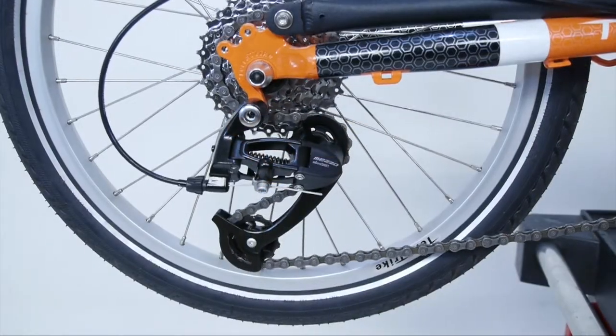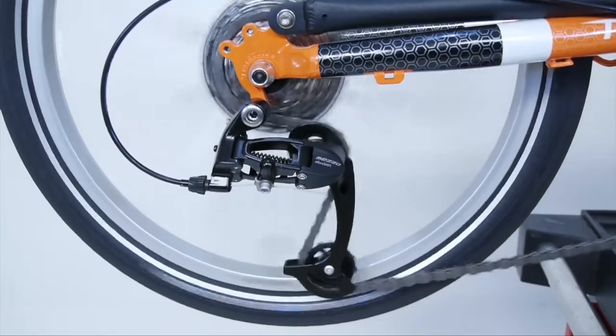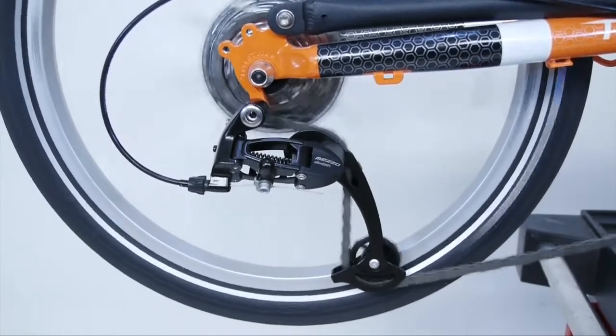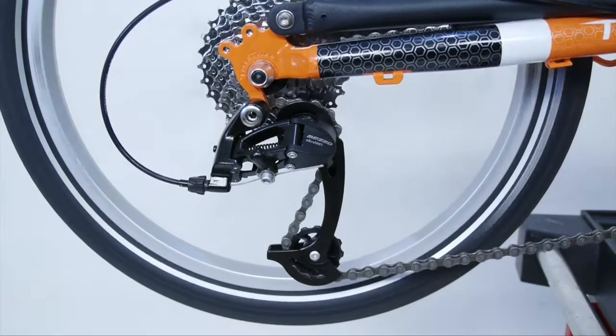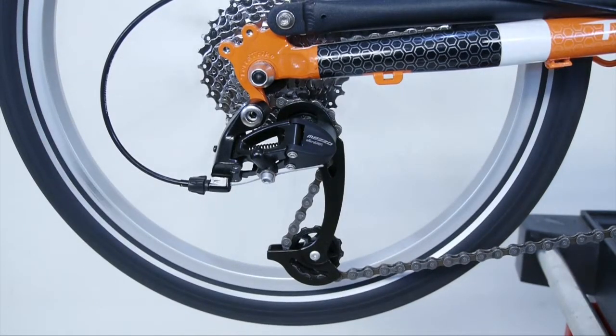If a trike is used for demos or test rides, always check the chain length before sending a customer out on the ride. To quickly check chain size, shift the trike to the big chain ring and the smallest cog and check that the derailleur cage is roughly perpendicular to the ground.